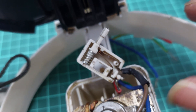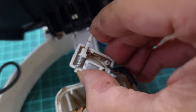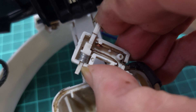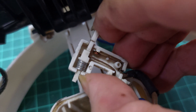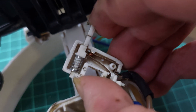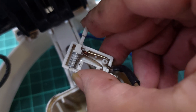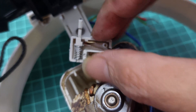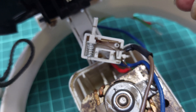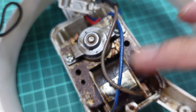I already opened the switch — this is the cover switch. When the cover closes it pushes the button, so there is no connection for the plate and the electricity turns off automatically. Most of the time both plates are covered with rust or corrosion and you need to clean it. I already cleaned it but the fan is still not working, so I'm gonna test the motor.